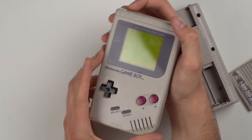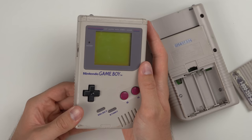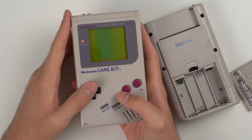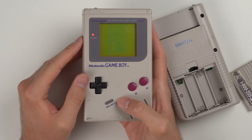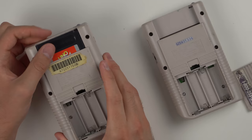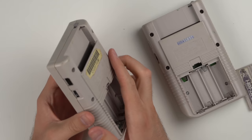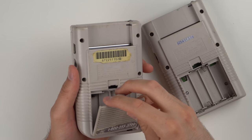Fresh batteries in the first Game Boy. Something pops up briefly — might help if I put a game in. When I roll the batteries around a little bit, it starts to boot up. We have a jacked up screen, but if we adjust the contrast we can see it. The Game Boy does work but the screen is very messed up — you can only see like half of it. This would be a great donor Game Boy for putting in a backlit or frontlit screen since it appears to work otherwise.